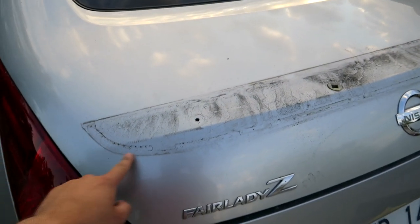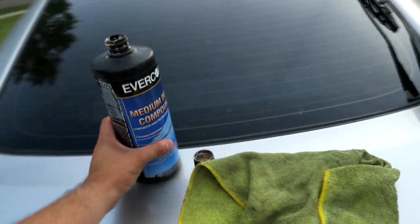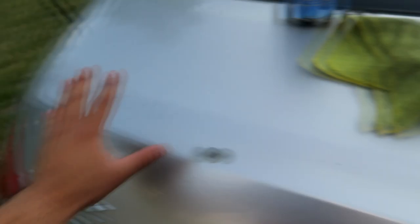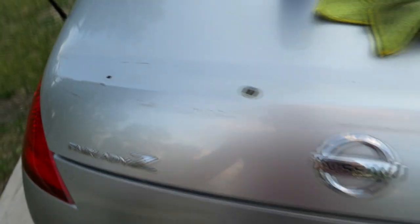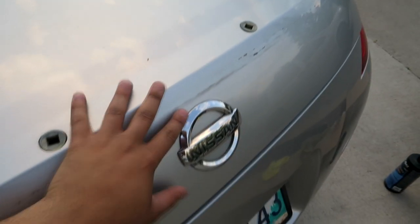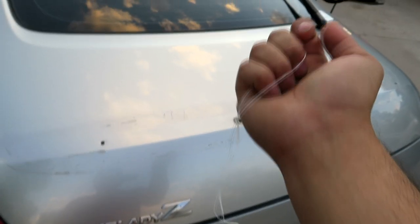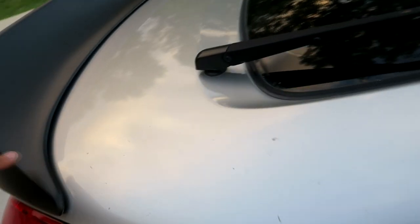Also, to take off the original wing — it was super easy for me because we removed it before. But usually from the factory, if you haven't removed it, there is 3M tape. You can go back and watch my other video when we did the facelift — what we used was fishing wire to cut through and wedge it out. We didn't put any 3M tape on the original one since we knew we were going to replace it anyway. Right now I'm using medium duty rubbing compound to remove all the residue. I might be planning on wrapping this car later on anyway, so it's good that we remove this and make it all smooth.